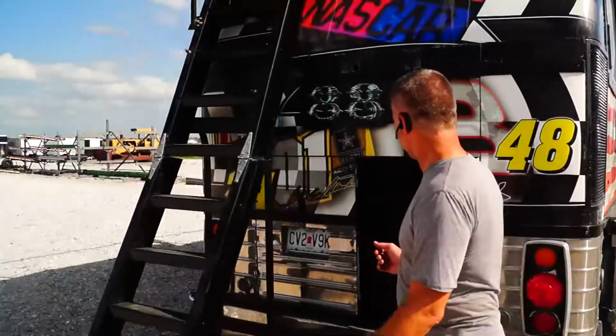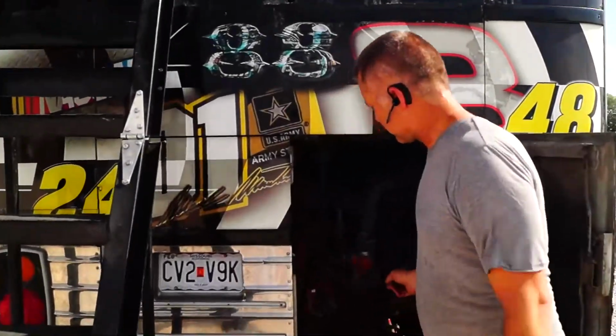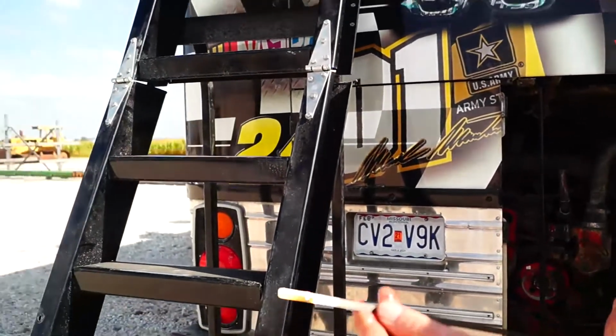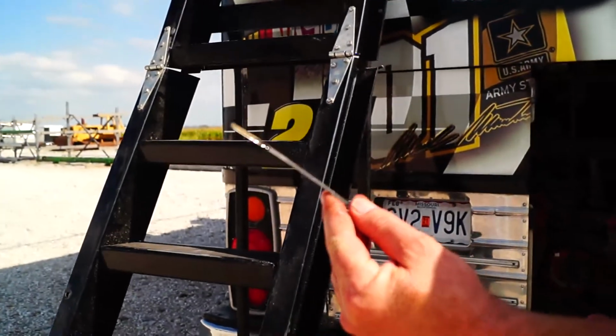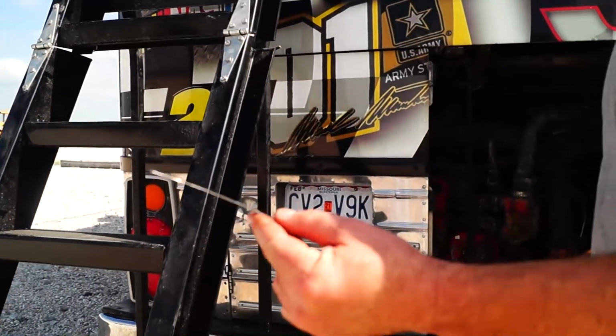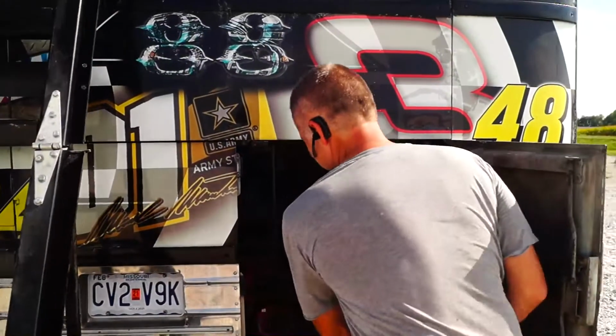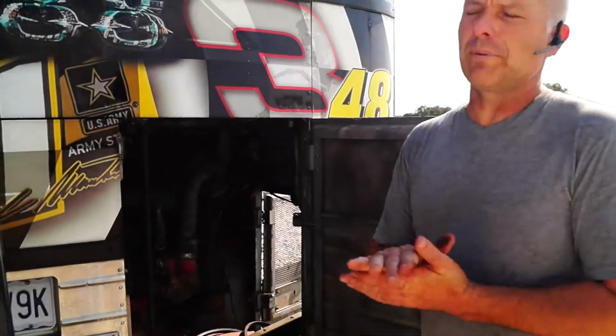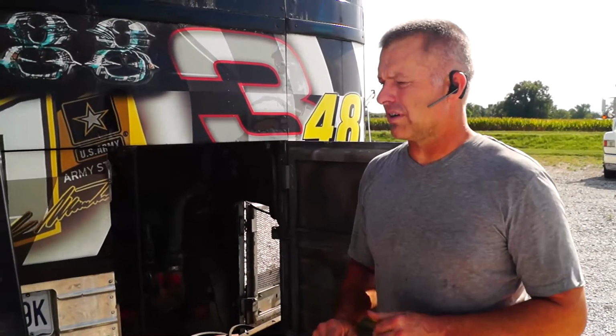I think the motor is in reasonably good condition, because he had this serviced before they put it up for sale, and I drove it 5.5 hours. Normally Detroit oil will be really black even just after the first time that you start it. But you can see on the dipstick, it's really clear even after a 5-hour trip. So I think the engine is probably in good condition. The oil pressure is still well above Detroit specs. At idle, when you start it up, it holds between 20 and 30, and going down the road, it holds about 38 to 40 still.